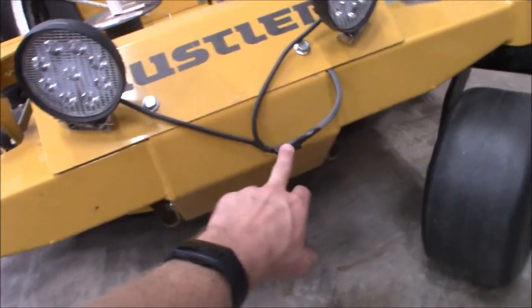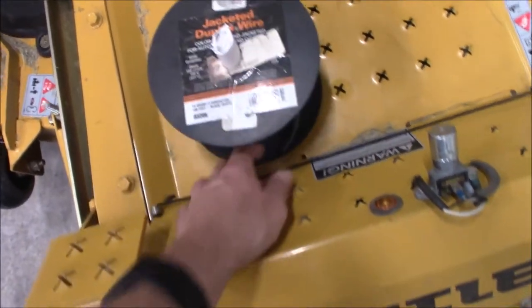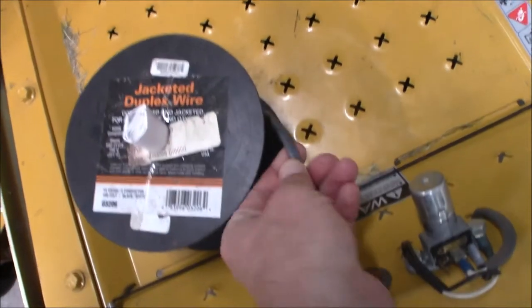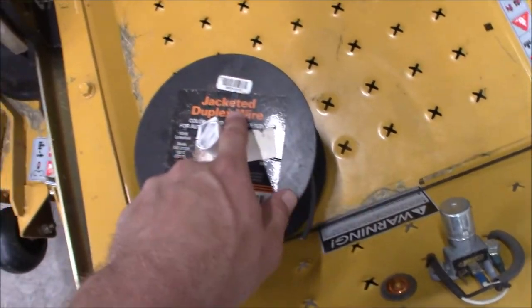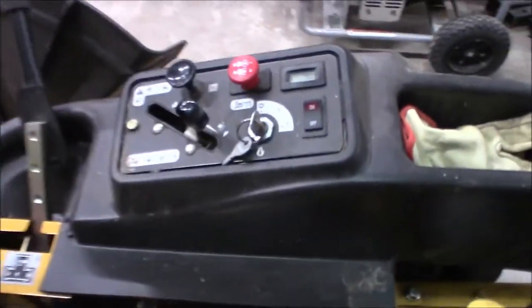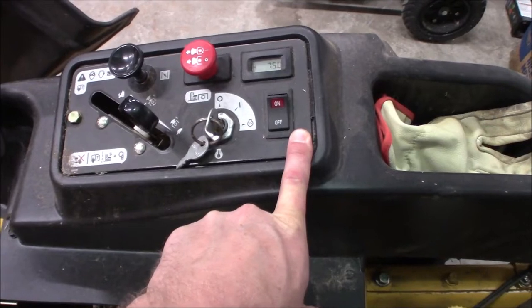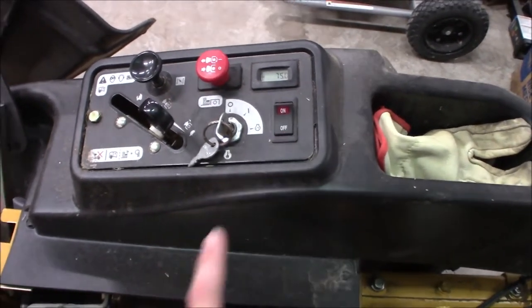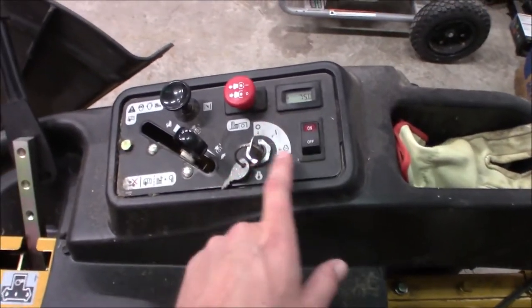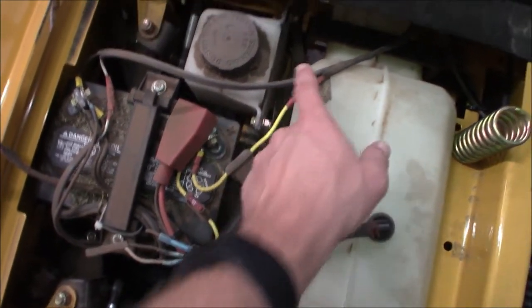Not the best wiring job — tied together with duplex wire, jacketed duplex wire. You can get it at Amazon or any auto parts store. It's just got two wires: power and ground, plus an extra jacket shield. I ran that down under the channel here with some zip ties to retain it. On this particular mower there's a factory spot for the switch, and a sticker just covers that spot. I got on DigiKey, ordered a switch, put it in — didn't tie into any factory wiring, it's just hot all the time. Came off of here with a fuse. You definitely want this fused directly up there to that switch, then it feeds out to the lights.